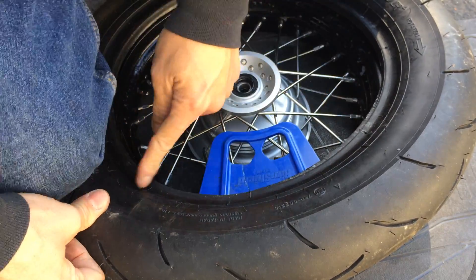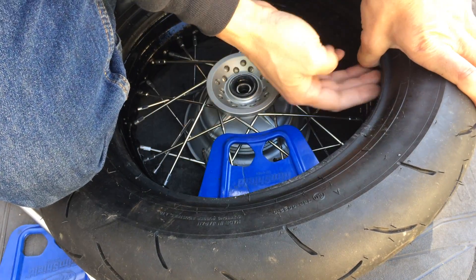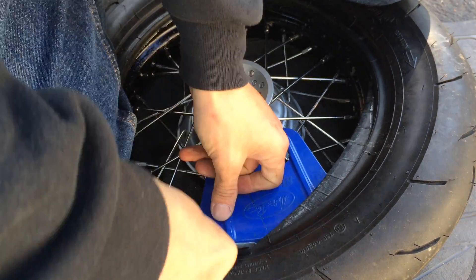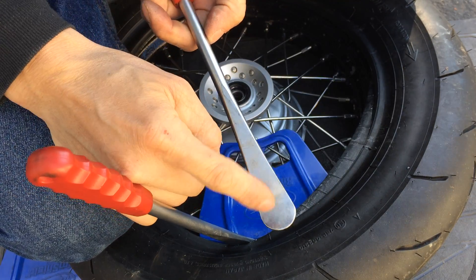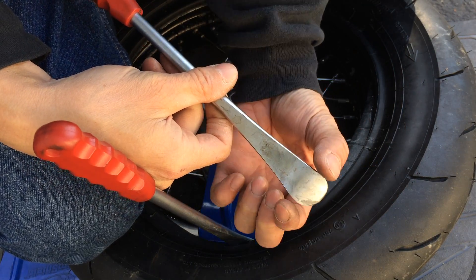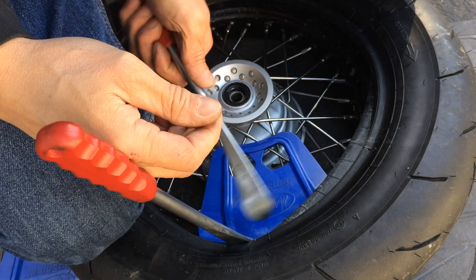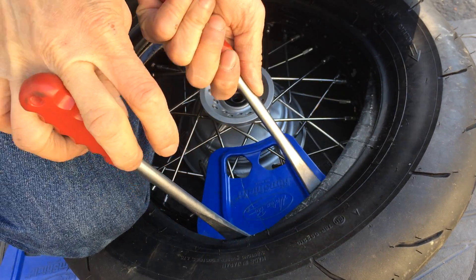Right now I'm using my knees to hold down the two sides where the rim sits between the beads. I'll get my tire lever. There are lots of different types of tire levers, or tire spoons, tire irons. This is probably my favorite type — the spoon where it tapers in. I don't like the type that's just straight, because that makes it harder to wiggle the tire iron around. I prefer these ones much better.